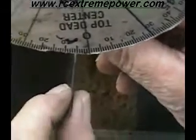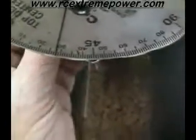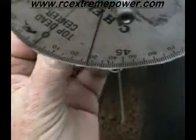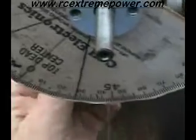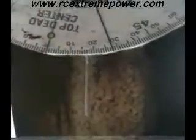I'm just a little bit off right there — 5 degrees. I'm saying that's top dead center. I'll put my positive piston stop back in. We'll see how close I am to top dead center with the piston stop. I'm going to pull it around until it stops — right there, 15, 16, 17 degrees again.